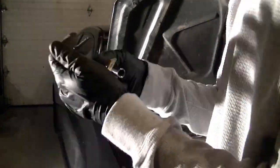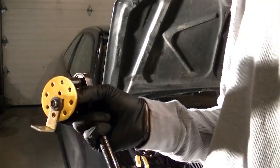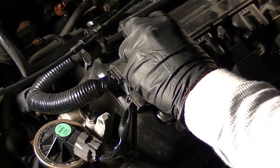Make sure that both your bolt and washer are bare steel, or else your grounding kit will be pretty much useless. I chose to mount the first wire to the valve cover here, where this bolt holds in the wiring harness. I didn't worry about the plastic being there because the washer and the valve cover create a good connection.